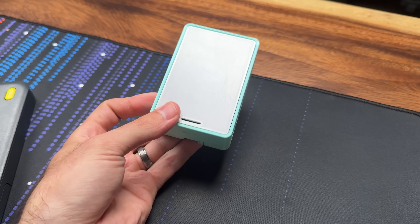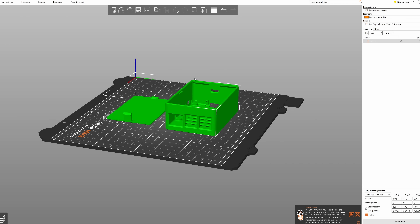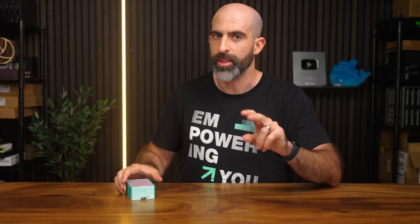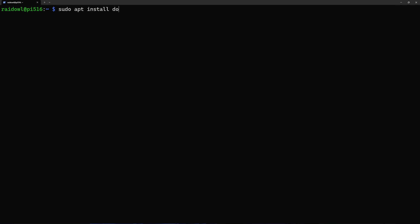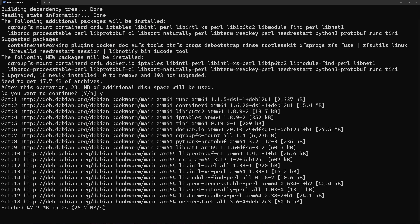After putting the drive back in, we're up and running. I have quite the colorful case using my fancy filament. I did end up stealing a design since I didn't plan on doing anything custom, so it's a bit underwhelming. But we have our Pi up and running, and to be a true server we are going to need one of three things: to host VMs, run Docker containers, or serve files over the network. We are going to be doing Docker and file serving. To get Docker installed, run sudo apt install docker.io.